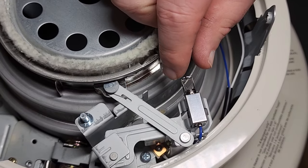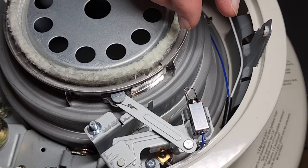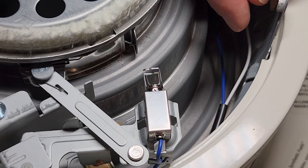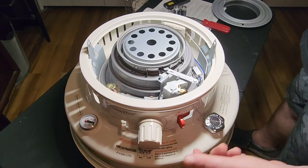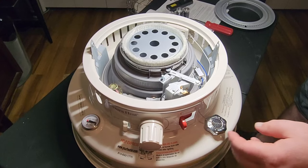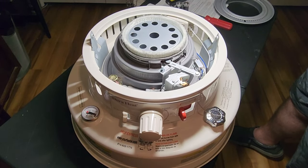To remove the igniter, turn it to the right — clockwise — and it should pull out. Note that's the opposite of the usual righty-tighty rule. When you go to install a new igniter plug, the model is DH-31 Type B. Push it in and turn it counterclockwise to install it. To test the ignition, raise the wick by turning the knob clockwise until it stops, then move the lever to the right. The igniter plug should be within one to two millimeters of the wick when the ignition lever is fully engaged. Reassemble the heater, replace the batteries, and you're done.